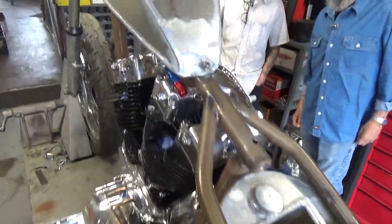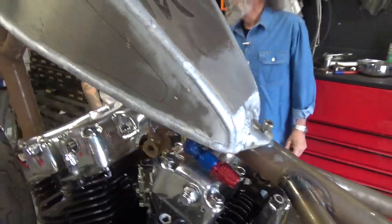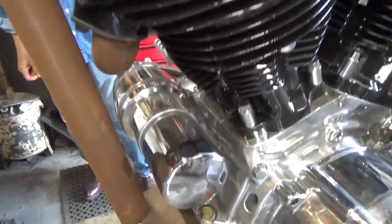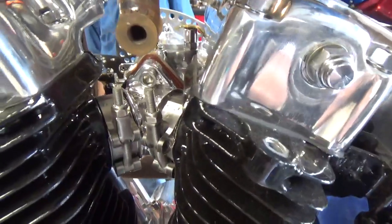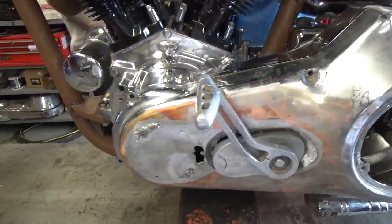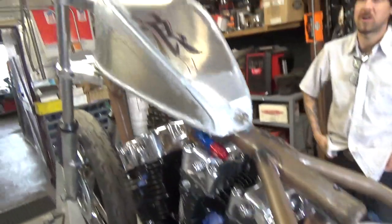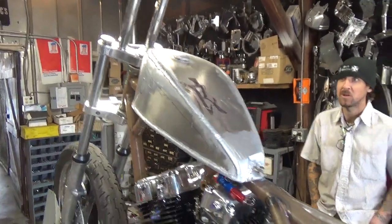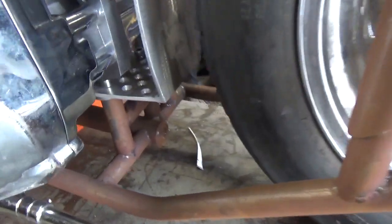The sheet metal — the idea was to try to make it look kind of like a drag racer fuel cell. I had this flat fender that my buddy had that came off an old drag bike. I made a horseshoe oil tank, and I made all this stuff from scratch. Kind of like a sportster tank but with a little aluminum flair to it. It's Frisco mounted up nice and high — should hold a lot of gas. I'm going to polish the aluminum to match the rest of the polish, then paint the frame black and chrome these nice high pipes.